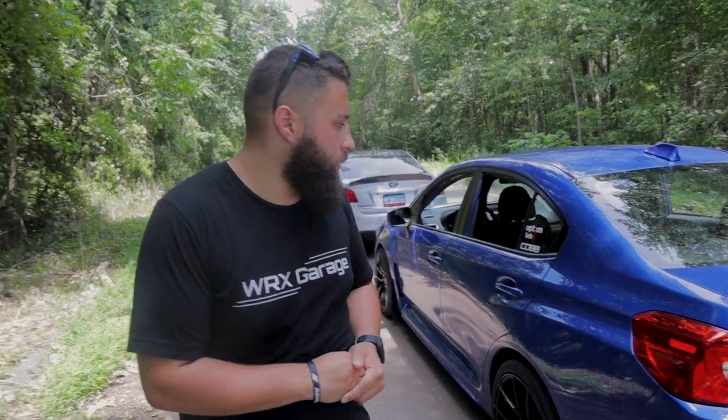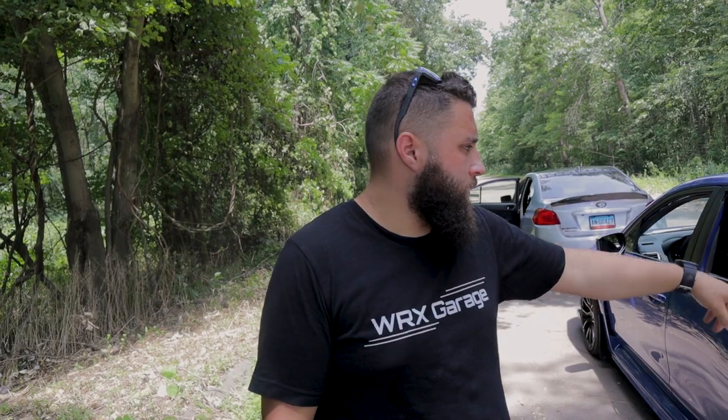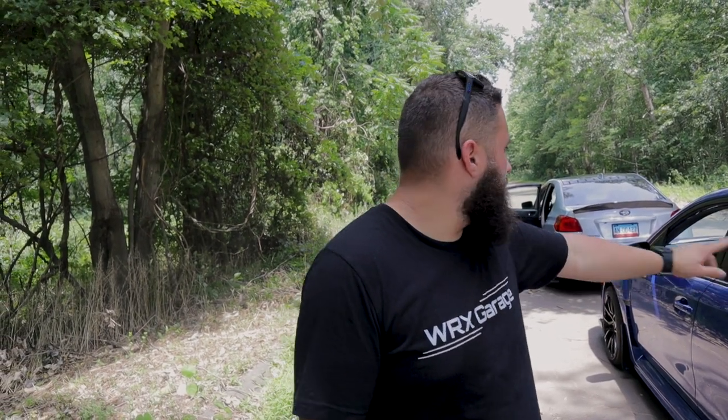I have the F-Spec on here — I think it's 8k front, 6k rear springs. It does have adjustability for the dampening and preload. It does not have camber adjustment, so you can't mess with camber, but we have a full review of the system.